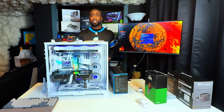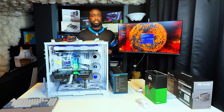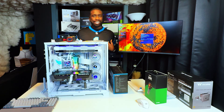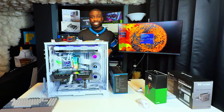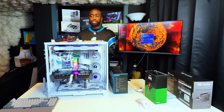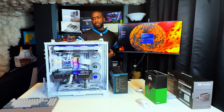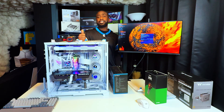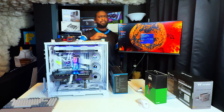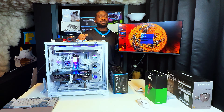The variables are different — he had a Founders Edition, this is MSI. I haven't broken down this MSI card to see how many shunt resistors they have. I've heard a lot about shunt resistors these last couple days, but that's not my area. I'm here to show you a real-world scenario of how things react. When I first got the 5090, I ran Call of Duty, Fortnite, and Marvel Rivals at max 4K settings with everything turned up — I wasn't even getting close to 500 watts TDP.